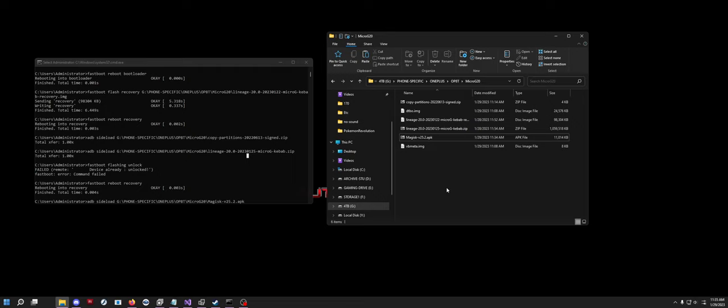Now that I'm actually inside the phone, I'm able to go to settings and enable USB debugging if it didn't stay enabled already through this reset process. Sometimes it does. So if you leave your phone plugged in through the reset process and go through the first time it boots, it will actually ask, hey, do you want USB debugging? And I always click yes. Good, my location's off. Cool.